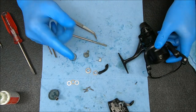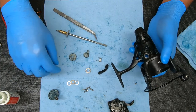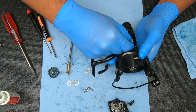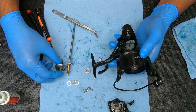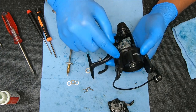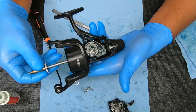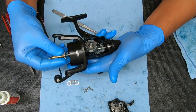Drop it on over it. Now we're going to take our bearing, drop that in here. Take our crosswind gear, get that set up kind of like that. Then we're going to take our block, rest that on there — looking just like this. Take our main gear, drop that in here as well. At this point you no longer want to move that rotor. Take the shaft, put that through there, line that up so it goes through, rotate it until it falls into the ratchet — like so. Line that up so this fits over it.